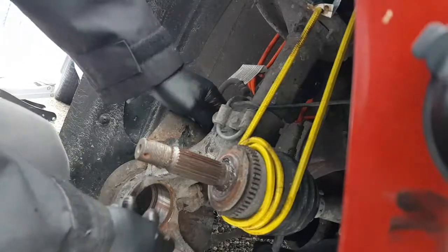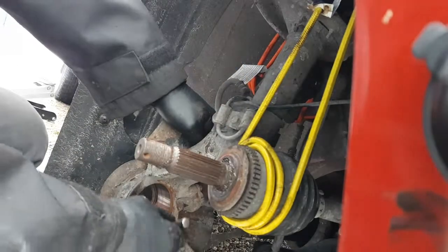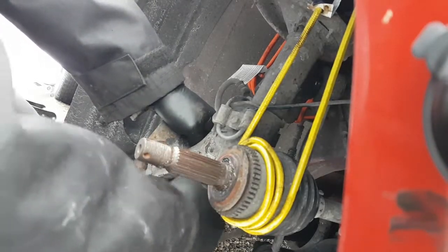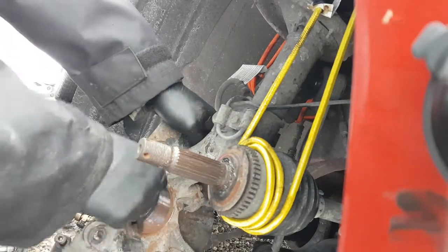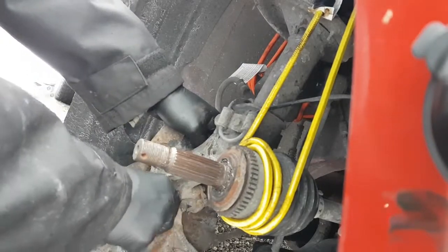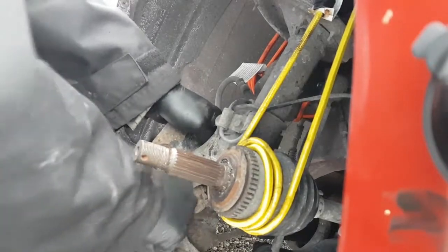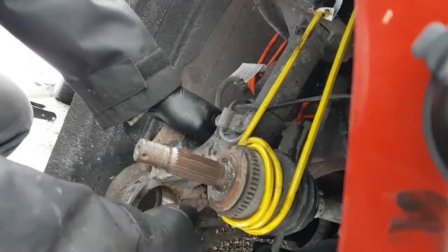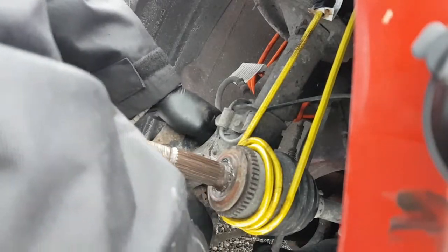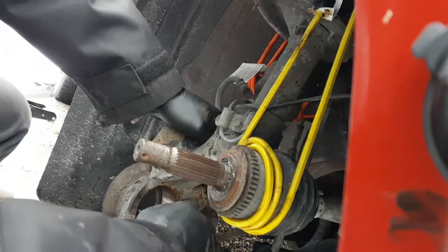Just a quick note, a way to tell if it's clean or not is I'm using my special punch that I made right now. This is pretty thick stuff in here. When it's clean, it'll sound like that, like it's just scraping. If there's still rust there, it'll sound kind of squeaky. Listen to this. And it sticks. That's how you know there's still a bunch of rust in there. And once you get it all cleaned out, it'll sound more scrapey like it does down here. See? Not squeaking as much anymore. And that's how you tell it's good and clean, and it's fresh steel.